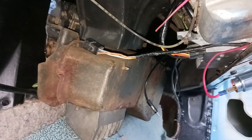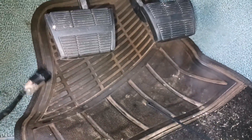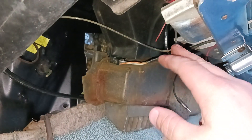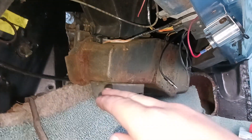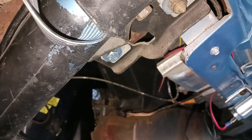You can find diagrams for replacement harnesses and you can find stuff for putting one in, but you can't find one for a factory original — that's my point. You see where that plug is? It's coming from a dash wire wrapped with black tape that's laying on top of the heater box. This is what's left of the console harness that I have for this car, and the best I can tell — I could be wrong, I often am — that wiring harness clips on to something in this area.